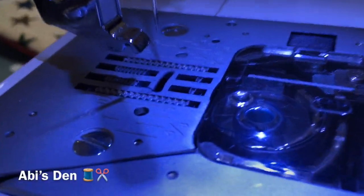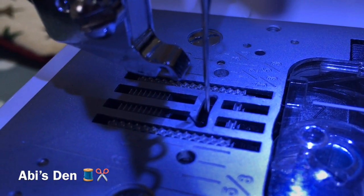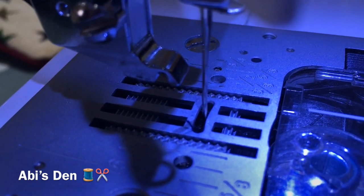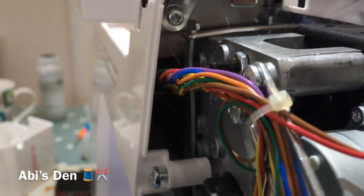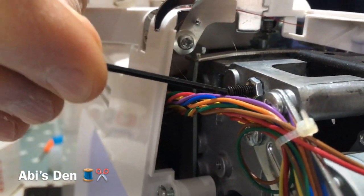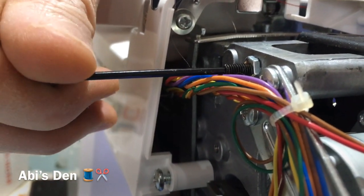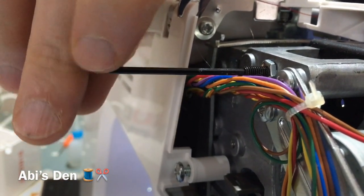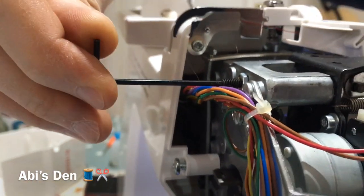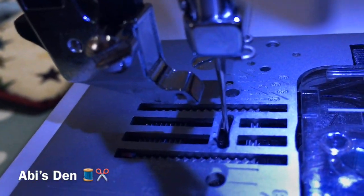Just nice and slow — we need to make sure the needle's not going to hit the needle plate. And it's just touching it. So what we need to do is get the Allen key back and rewind some of those movements. We went anti-clockwise before, so we need to go clockwise. We turned it one and three quarters, then another half, then back half.